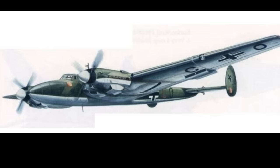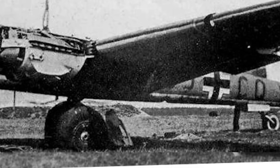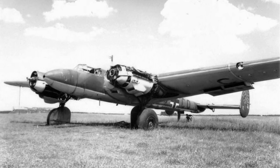To cut down on drag and to keep the airframe as aerodynamically clean as possible, all landing gear were retractable, including the tailwheel. The tires were all large and of the low-pressure tundra tire type variety, which are best suited for operating on rough grass strips. Perhaps the thinking was that this aircraft would be operating over extreme ranges over uninhabited regions where the aerodrome facilities could be very rudimentary.